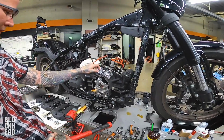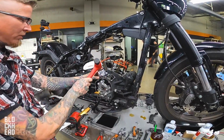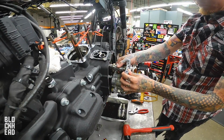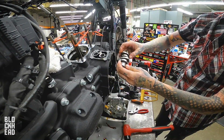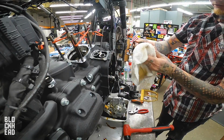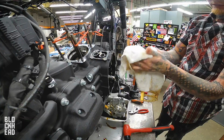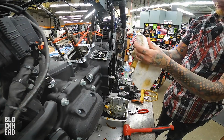These are gonna go flying, and so will the screws. We were starting the cam up already. So this is your inner bearing surface. It looks fine. These are your lobes. Each one of your lifters rolled on these. We're just looking for any excessive scoring or anything like that, which this looks fine. And you could definitely see where it was riding heavier, but that's normal.